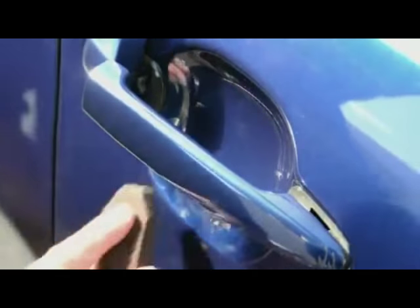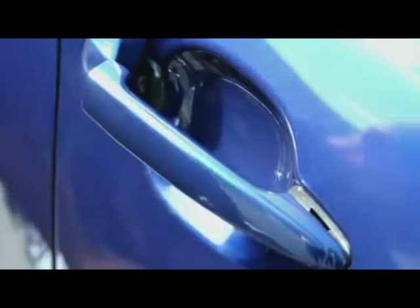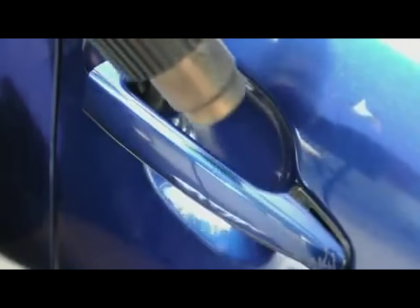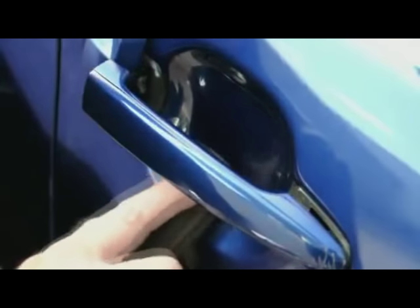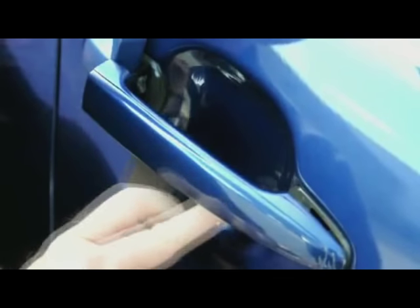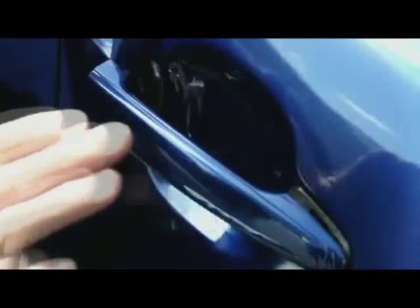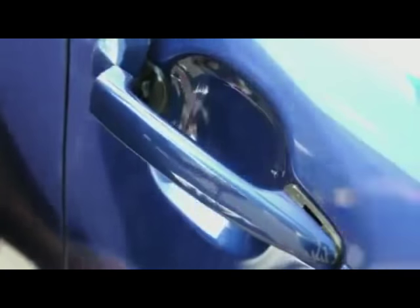You do one side at a time. Water comes out, vinyl lays down. You know when you've put enough heat on it when you see it shrink slightly. Now if for some reason you get a section that doesn't want to behave, you can still slide it — you have the liquid inside so you can still move it around. You just don't want to press down while it's wrinkled, because you can actually press a wrinkle in permanently. If that happens, it's too late — you actually have to put a new piece on there.